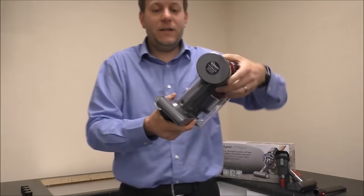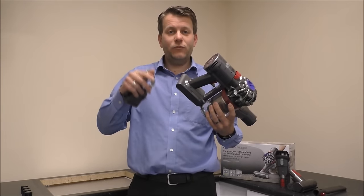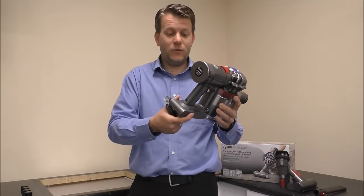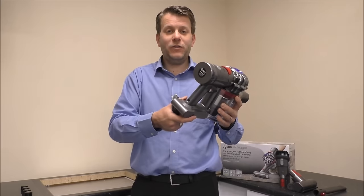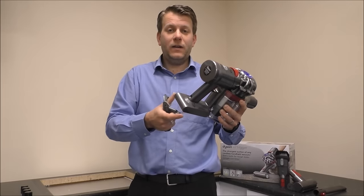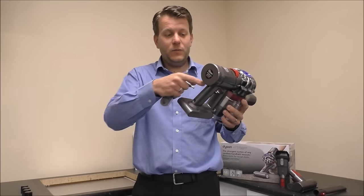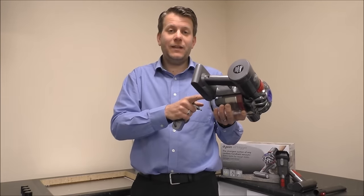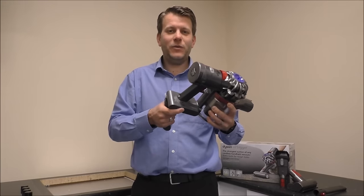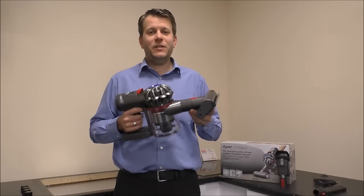What you'll also find with these cleaners is that after a time, the battery will need to be replaced, because as with any cordless device, the runtime you'll get will gradually decrease. The beauty of these — and again, the same with any of the Dyson cordless ones — is that you can actually replace the battery. It is a very easy process, just undoing a couple of screws here. We do recommend getting the genuine Dyson battery, although there are quite a few aftermarket ones. Once you've undone that and a couple of screws underneath, the battery will pull off and you can just replace it. But you shouldn't need to do this for several years. If you're after buying one of these, I have provided a link below to show you where to get one at a very competitive price.